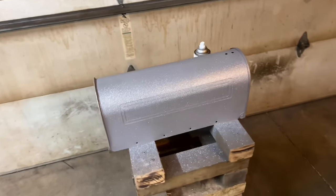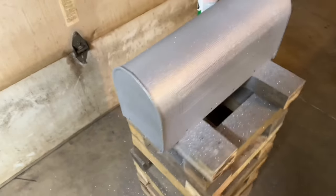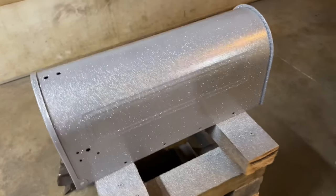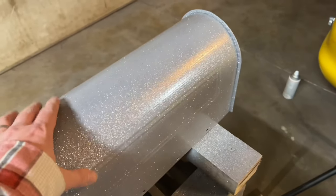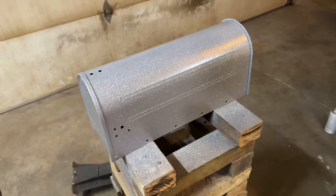We got our silver metal flake base on out of an aerosol can — I'd say that's pretty good. We'll let that sit overnight. I got it in clear, just 2K out of a can, nothing crazy. It looks cool as it is, but I'm going to take some 600 grit and wet sand it down smooth so tape will stick, and then we're just going to start playing around with tape.